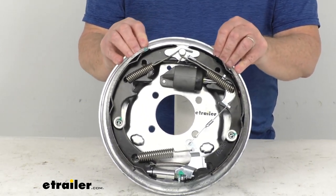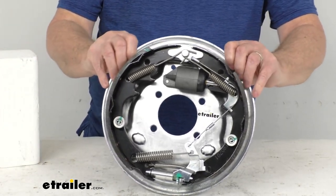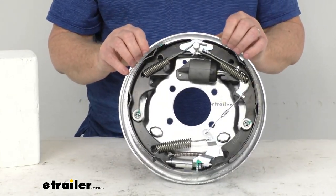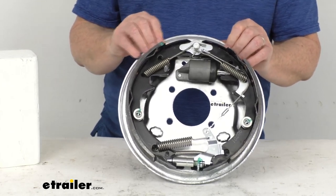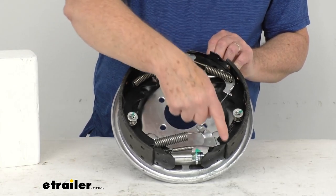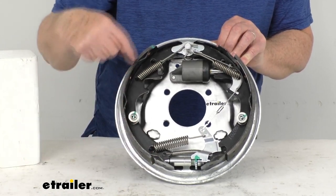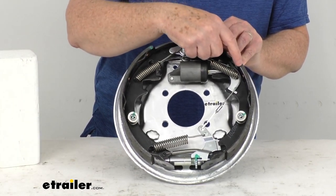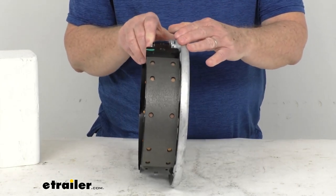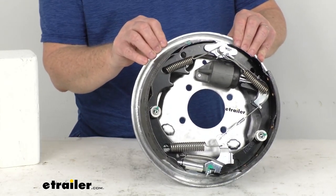The configuration for this is a right hand passenger side assembly. You can tell that on a brake assembly — this one has a sticker on the back that says R for right hand side. But if that sticker wasn't there, the easiest way to tell what side it goes on is to look at the length of the pad on the brake shoe. The longer pad is on one shoe, and the shorter pad is the primary shoe, which always faces the front of the trailer — telling you this goes on the passenger side or right hand side of the tow dolly.